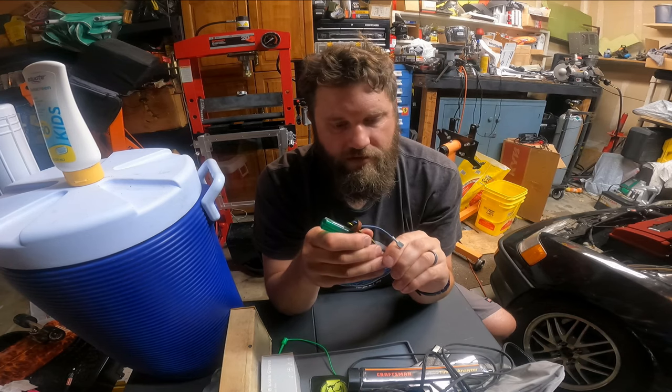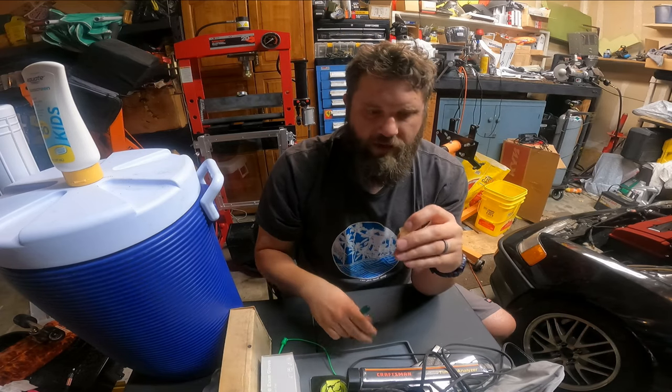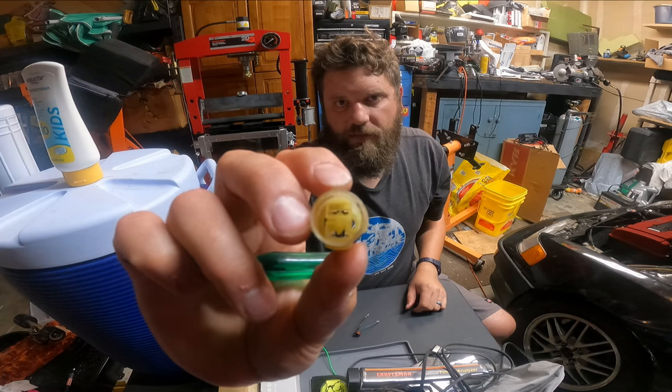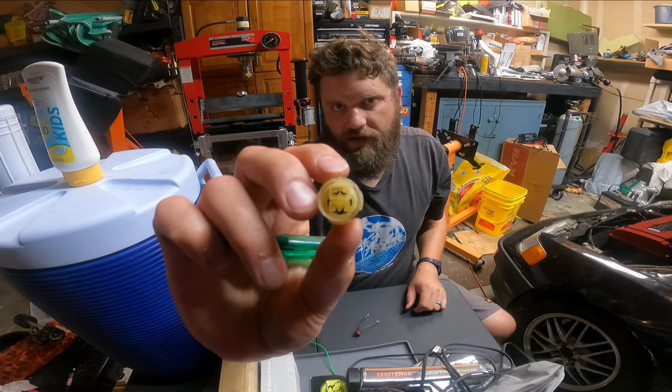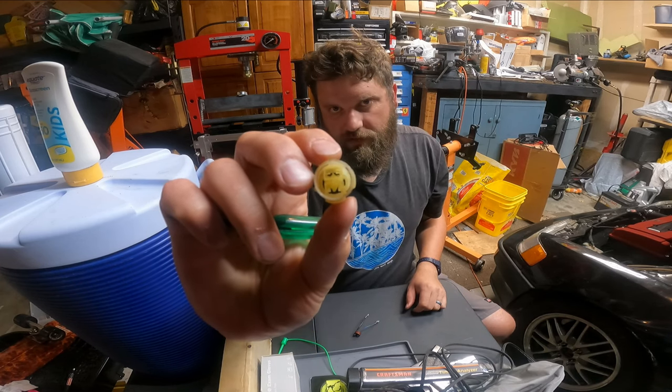This coil power wire is quite a bit larger gauge, so it's a little bit trickier to get out — there's less space — but that one came out pretty easily. Now what you're left with is an empty cannon plug, and you can see on the inside the little plastic connectors that hold in the spade clip.